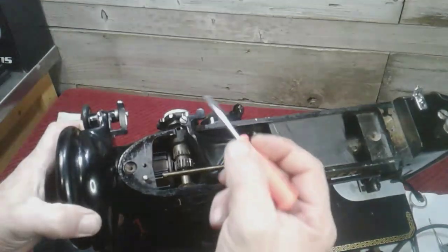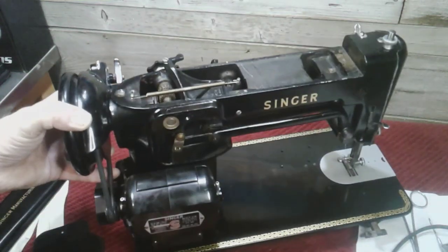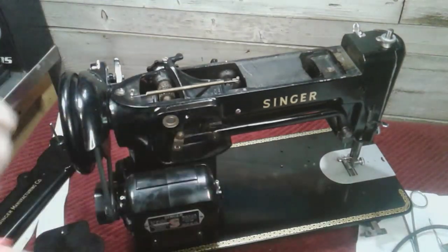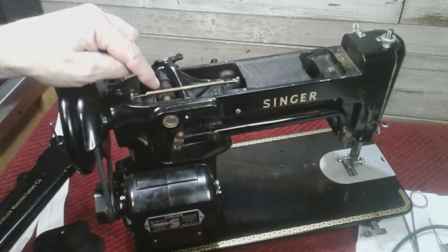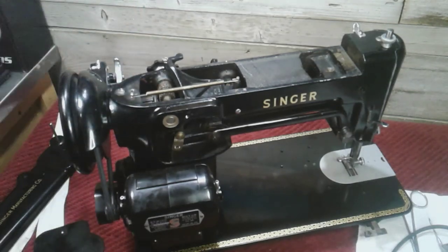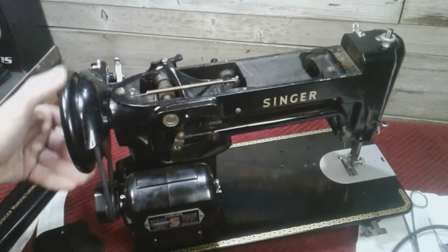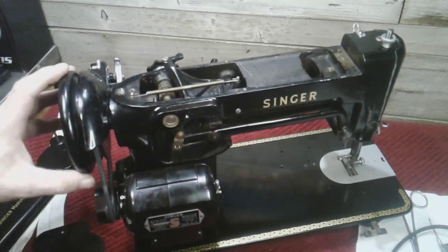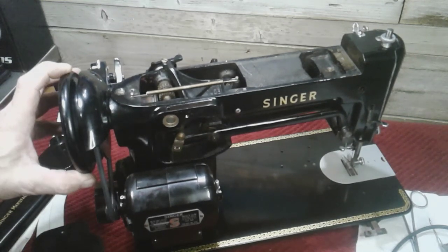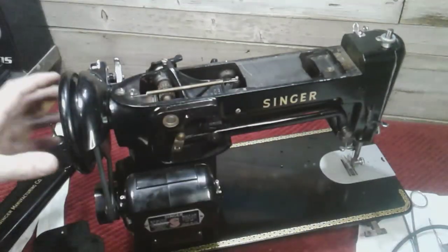You can notice I do need some grease on here. What I did was put one drop of oil on there to loosen up the old stuff while I ran the machine, and I used a Q-tip to clean out those gears, because I'm going to put some fresh grease on there. I'm only doing my service right now — once I get the machine running free and smooth like it is now, that's when I'll grease everything when I'm ready for the final cleaning and reassembly.